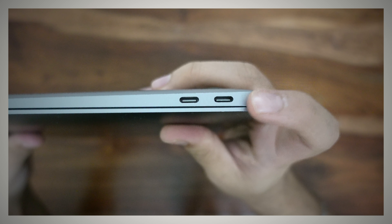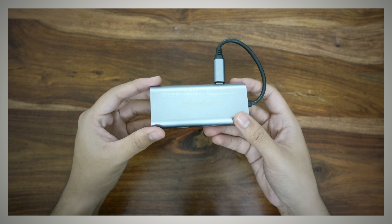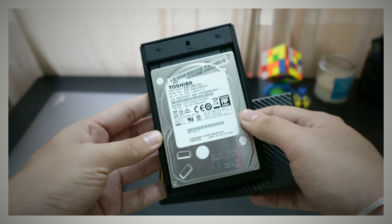The next thing is this USB-C hub from Amazon Basics. If you buy a MacBook Air, you only have two USB-C ports and a 3.5mm headphone jack, so a USB-C hub is the most important accessory you should buy with your MacBook. I don't recommend this Amazon Basics USB-C hub though, because after a bit of use it gets very hot and automatically disconnects from my MacBook. If you're tight on budget, a cheap USB-C hub works, but for intense work sessions I'd recommend buying something above 3,000 rupees, like from Anker or Ugreen.